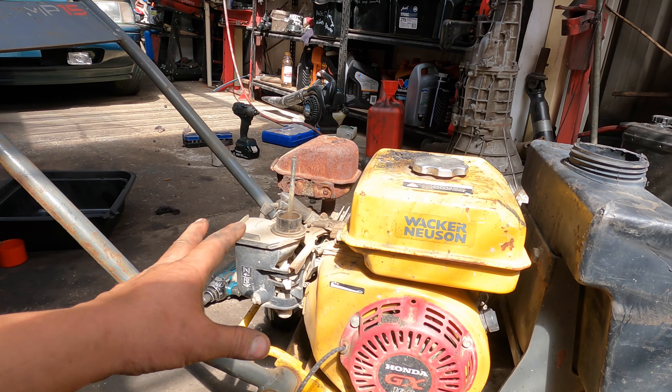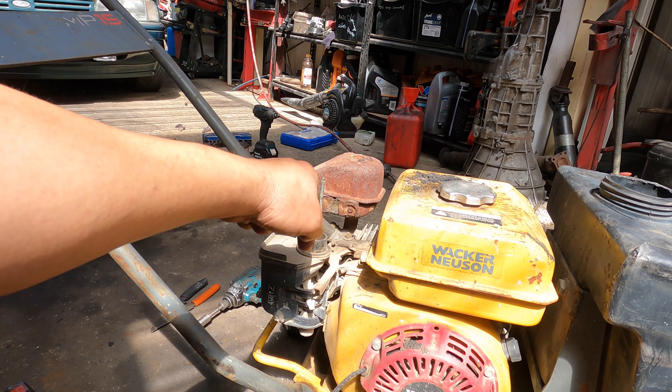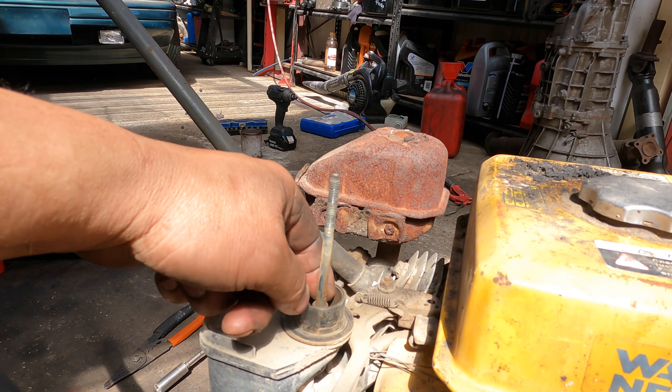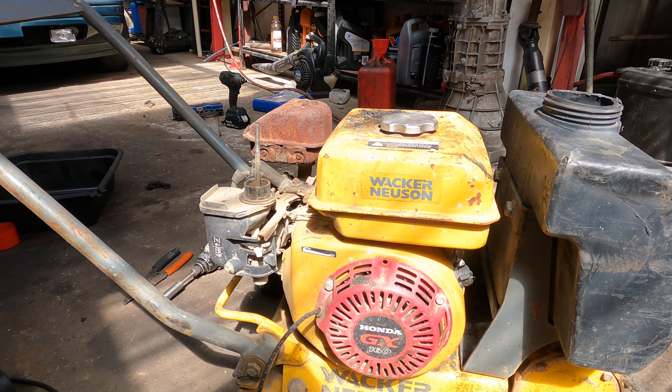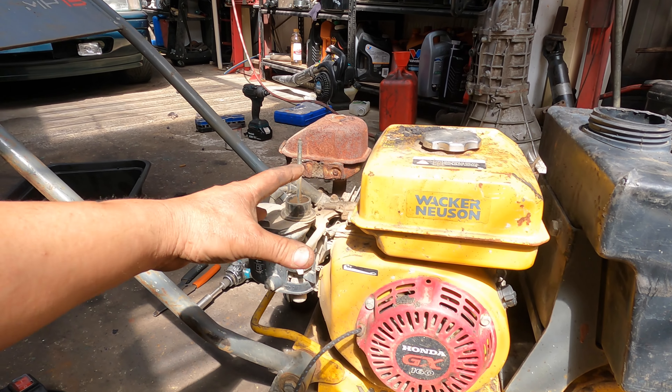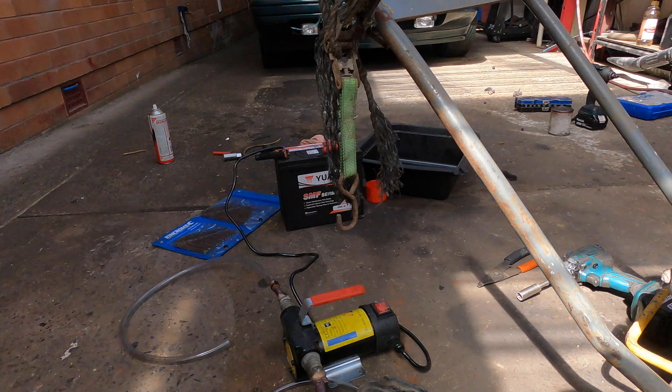Okay, what I do today is very easy for this one. First of all, check the oil. You can see the carb is full of dust and all sorts of stuff in here, and the switch has stopped. So we take all this out, clean the carb, and get the oil out — get all the old oil out with my sucker.